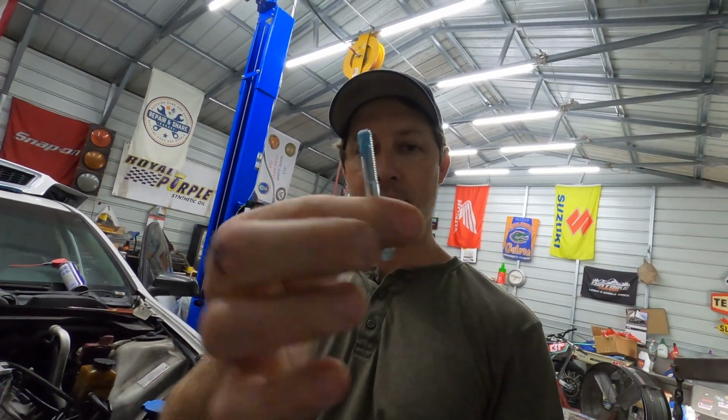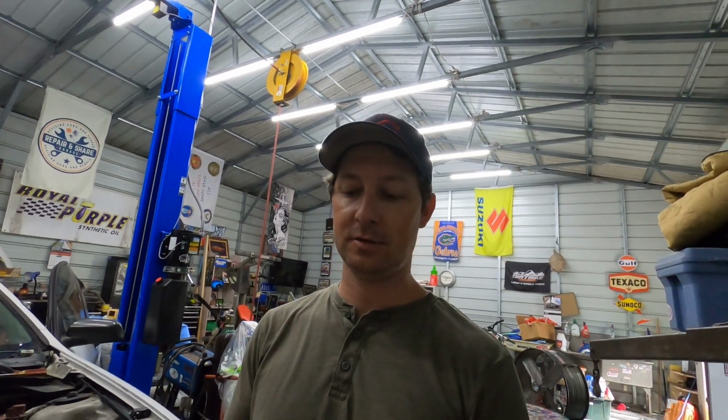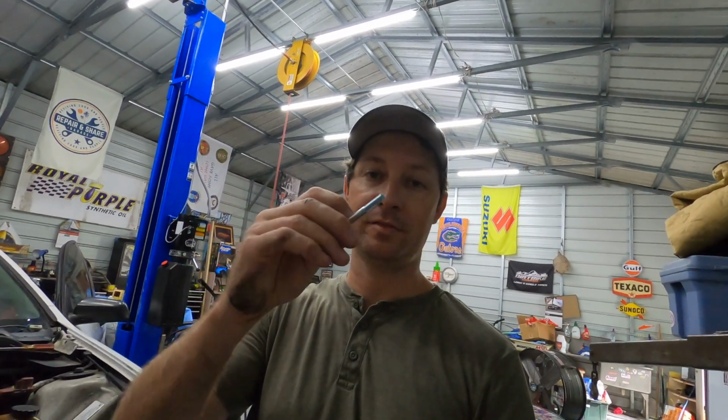We're gonna start now with putting these 10 bolts in with a little bit of blue thread locker right on the ends, just a little bit. If you got a magnet, I would highly recommend using a magnet to lower them in there, because it goes straight into the engine if one of these slips out of your finger. But that's just what I'm doing. So we're getting there. Almost got it.